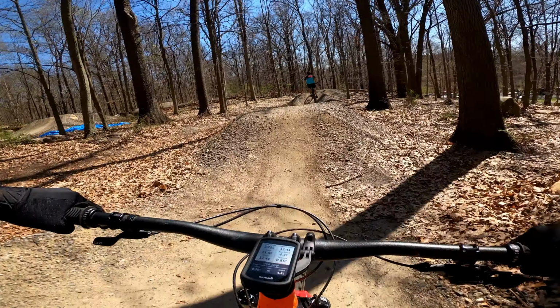So of course a few rides later I figured this out, and I lowered it back down to about 70 psi and made the rebound almost as fast as possible. And now it's feeling a lot better over chunky trails and when I want to jump off stuff, so that's really good. But just keep in mind that this whole video I'm running almost 30 psi too much in this fork, and the rebound is now slower than it ever should be for my weight and riding style. So there's an excuse for me, you know?